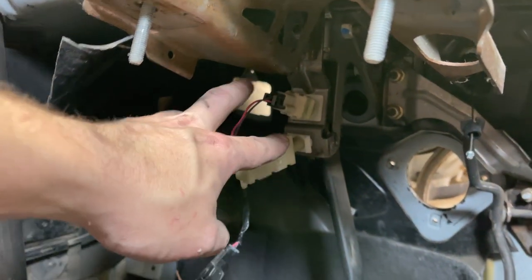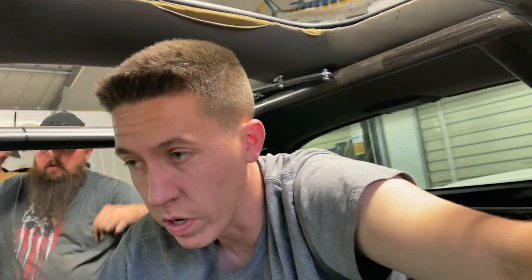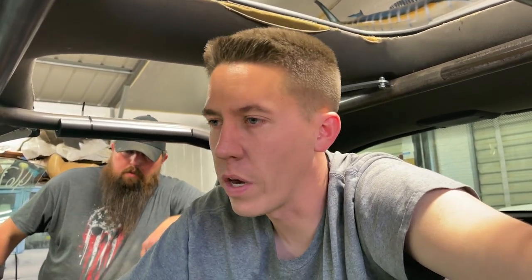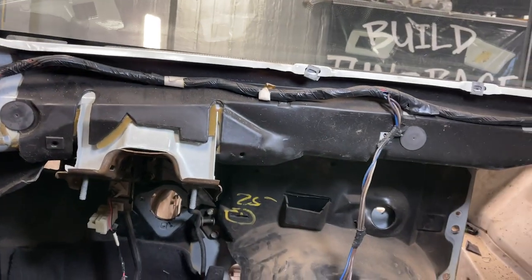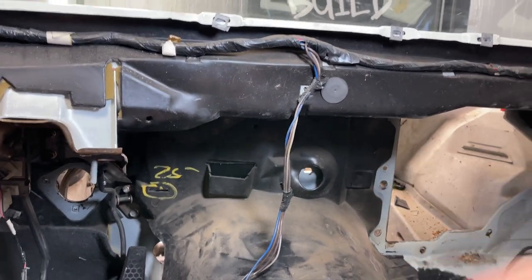I went ahead and kept the brake switch and the little harness with the pigtail on it, so then I can rewire and reuse that brake switch. I could always get a pressure switch, but if we can use that brake switch and wire it back in, it'll be real nice. I'm planning on hanging the new wiring harness somewhere up under the dash, so build little brackets or something, come down maybe off of the crossbar when I add to the roll bar. So if you know what that means, then you probably understand where this is going with the roll cage too.